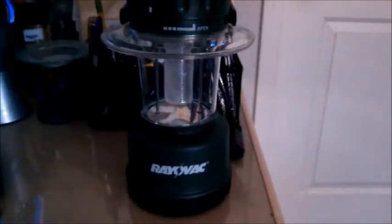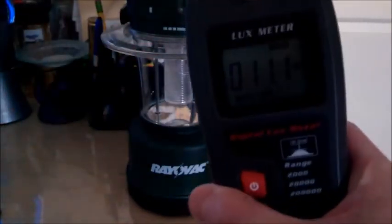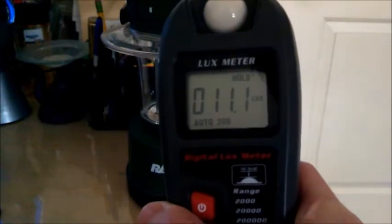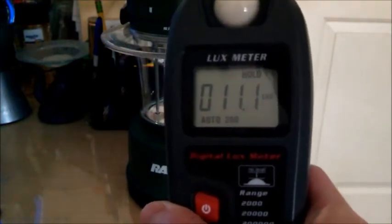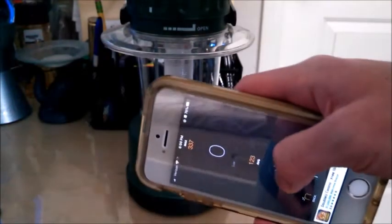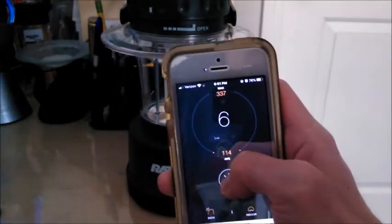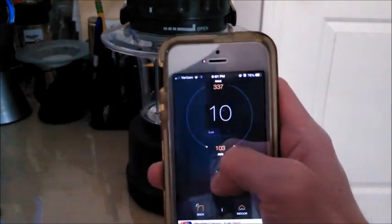The first thing to see is whether the app is measuring anything at all. I turned off the lights so the only source of light coming in should be from the window — it's a pretty overcast day. At any given area in this room there should be a very low but detectable amount of light. Using the digital lux meter, that off lantern is reflecting about 11 lux, which is pretty dim. So let's see if the app can pick it up using the rear camera — and it's picking up about as much as you would expect.